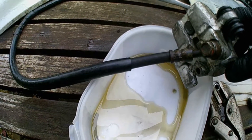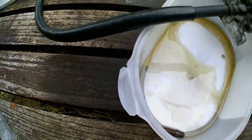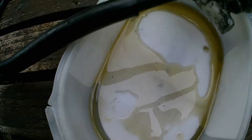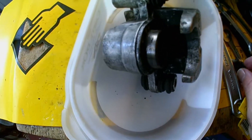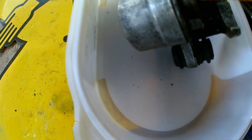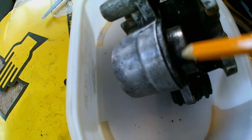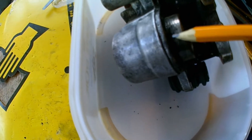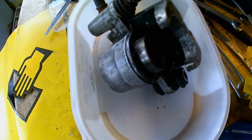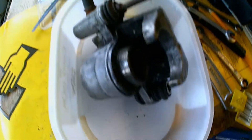I just pushed the piston back in there and managed to catch all the brake fluid that came flying out — actually better than the Suzuki. Looking further, the bleed nipple is a bit rusty but dry at the end. Looking inside, there is some brake fluid that's just dripped out. This should be sealed with rubber and it's totally disappeared — whether someone used heat and burned it off I don't know. The piston needs to come out for a new seal.